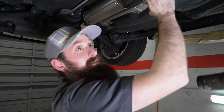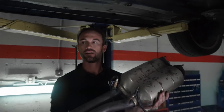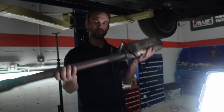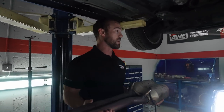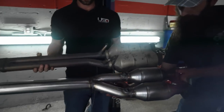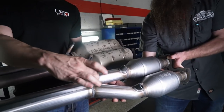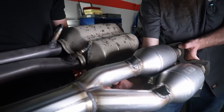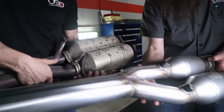What I did was I just pulled the whole exhaust back a little bit and that gave Chris enough room to remove the front section. As you can see, the factory cat section also has a little bit of a benefit as far as weight — I want to say it's probably about a 10 pound savings. For size comparison, that's what we're looking at in the difference. So just so you guys know, this is a two inch pipe that V's into a nice transition that goes to a two-and-a-half inch stainless steel pipe, and of course it has our 200 cell high-flow cats in it as well.